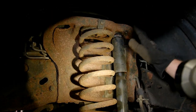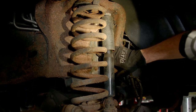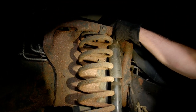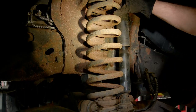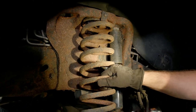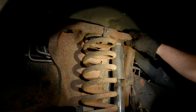What makes it difficult is number one it's an old truck and it's really rusted, but this tower is actually riveted onto the frame, so all these have to be cut and ground off to remove it — the new one is going to bolt into place. It's a messy and not necessarily fun job, but it's got to get done. Before I do anything, I'm going to spray all this with PB Blaster to hopefully have some of it come out a little easier, since we need to remove this coil spring, the shock, and then start cutting away the tower.